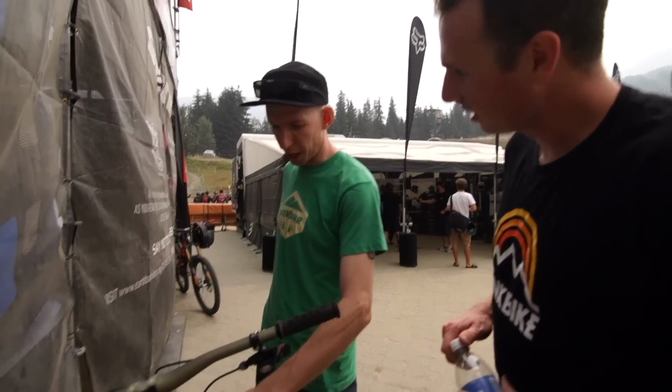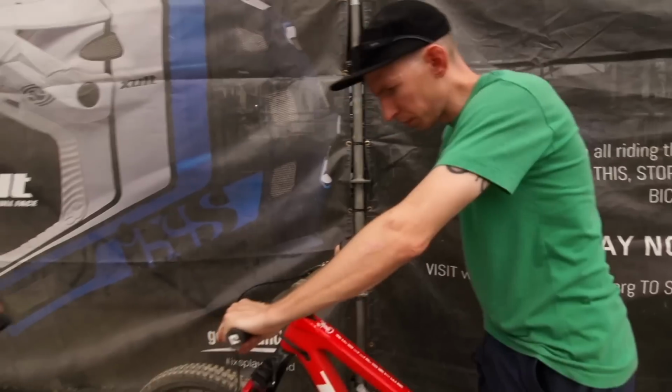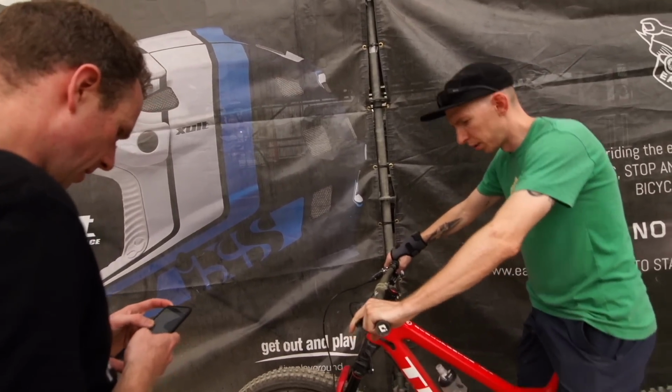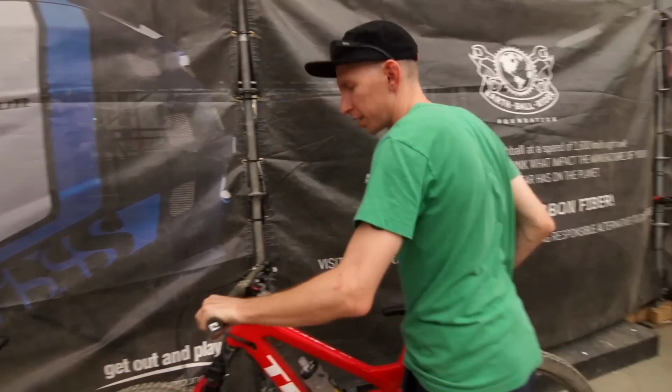So I think I'm just gonna back off your high speed just 1. So let me just make sure that you have. Does that come out at 75? Yeah, we dropped down to 75 on that. And then your 1 click of compression. Actually, I changed my mind. It's just 1 click of rebound.